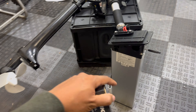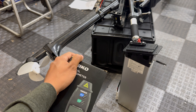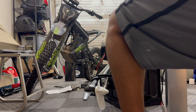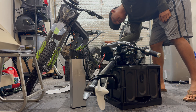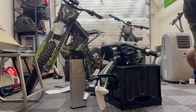I'm going to measure the prop speed with this digital tachometer at full throttle to see how fast it spins the prop at 52 volts, so we have something to compare to when we hook up the 72-volt battery. I'm just going to cut a section of this silver tape to put on the prop.